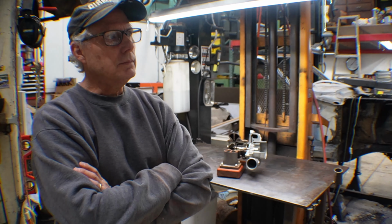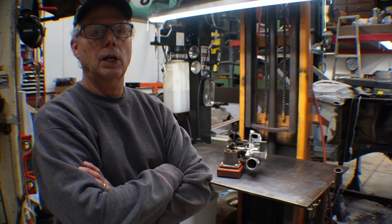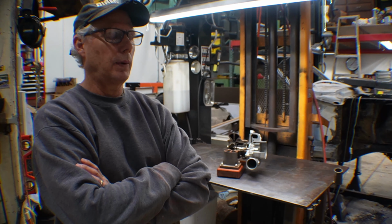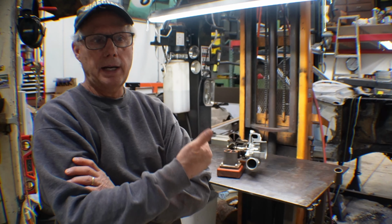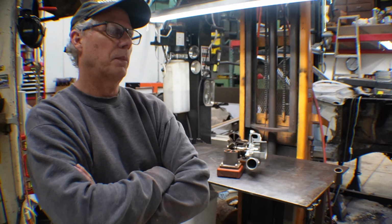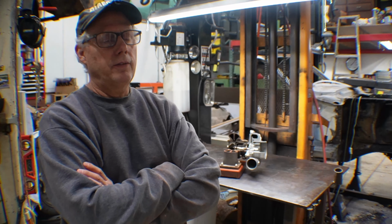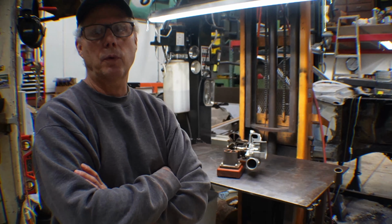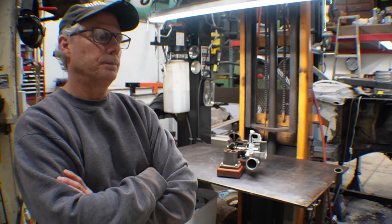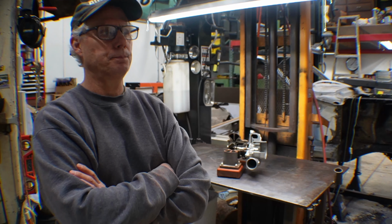A lot of people just look at the horsepower number and go, I need to have that, but that's really not the right way to do it. You have to understand what your pressure ratio is going to be, where your surge limit is, if it's on a compression ignition engine or a spark ignition engine, 2-valve, 4-valve. Like if you want to make 600 horsepower with a 4-cylinder, it's different than making 600 horsepower with a V8. So it's not the same turbo for those applications, right?